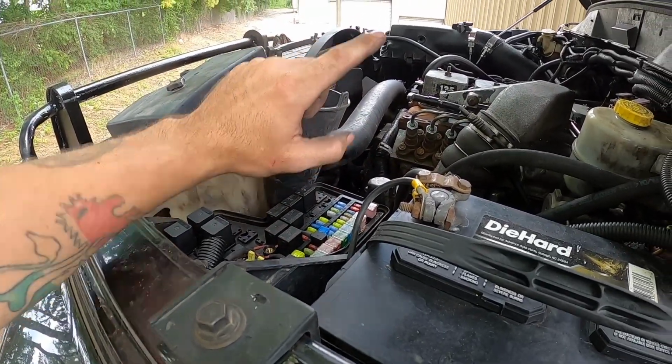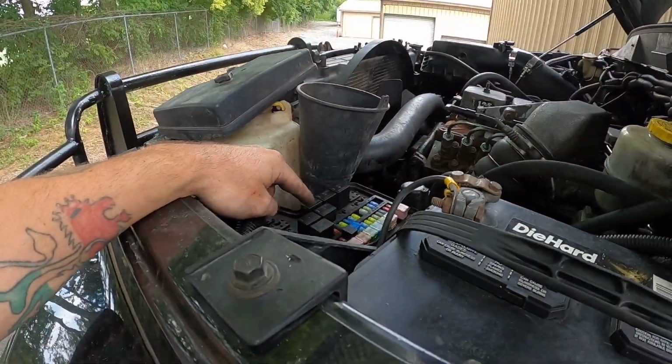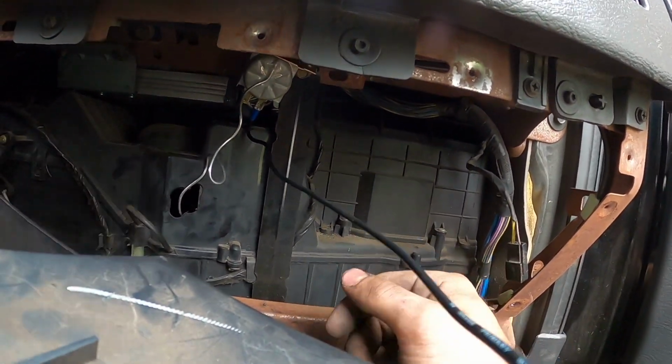The only difference is, instead of the ECU sending ground to this, it'll be that switch that sends ground to this. So that's what we're gonna do, because then it's gonna be completely factory looking. I don't gotta butcher any wires, and it'll go pretty good. That is how I'm gonna do it. So I'm gonna take one of those and ground it, like right somewhere in this area, and it's gonna be done correctly. And we're gonna have factory wiring and factory AC,